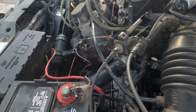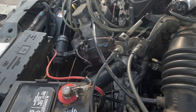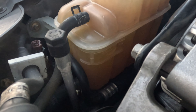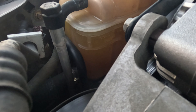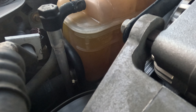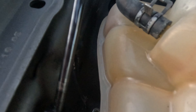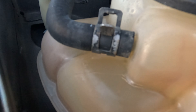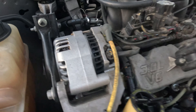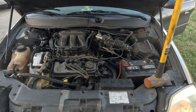The fans are working. Seems like it's regulating its temperature, and the gauge did drop back down a hair, indicating that it took care of its air bubble finally. Right at the top of the cold still. I can see water moving through the heater circuit here — the water pump is working. Hopefully I took care of it. Just need to drive it in the daytime in the heat tomorrow with the AC on to see if it still does it.